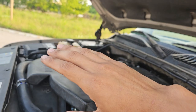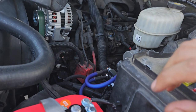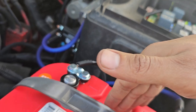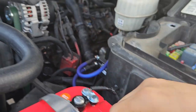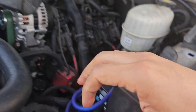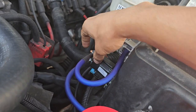And only use that auxiliary battery, isolating the main one. That way, if you completely kill the auxiliary battery and go to start the car, when you turn the key to the run position it's going to start with the main battery. In first position this relay is off — auxiliary only. When you go to run or key-on position, this relay is powered and they are both connected.